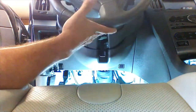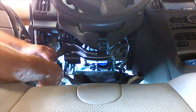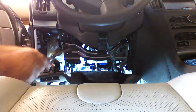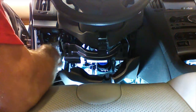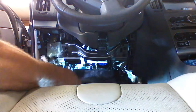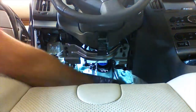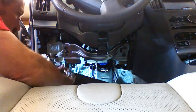We're going to put the steering wheel in the full upright position so that we have clearance to get this dash to release. We're going to unplug all of the plugs from the back of the dash. Depending on what options the vehicle has will determine how many plugs you'll have to remove. That is the trunk release, this is the traction control. We have a key port — we're going to use it when we program our device, so we'll unplug it for now. We're also going to unplug the climate control apparatus, which has a rubber hose and a plug. We're going to release the diagnostic plug from its holder by pressing the ears on the side end and releasing it from the metal.